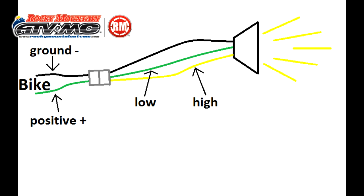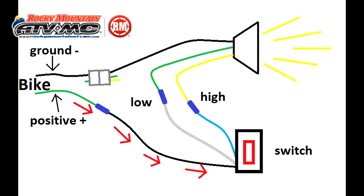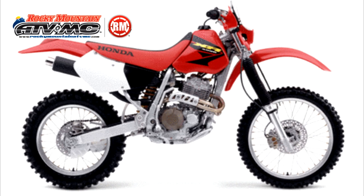Using this illustration I'll show you how it's done. Here I show the positive and negative wires coming off the bike and the high, low, and negative wires running to the headlight. Here I'm showing how the three wires from the switch should be spliced into the bike's headlight wires. The positive lead from the bike is redirected into the black wire on the switch. The white wire from the switch is directed into the low beam on the headlight and the blue wire into the high beam. Notice the negative or ground wire from the bike to the headlight is left alone. So when the bike is started the power is redirected into the black wire on the switch; when we turn the switch to low the power is directed out the white wire to the headlight, and when we turn the switch to high it's directed out the blue wire to the high beam. It's important to note that not all bikes come with dual filament bulbs — an XR400 is a good example. Without an aftermarket headlight it doesn't have a high/low option, so you would only hook up the low beam wire.